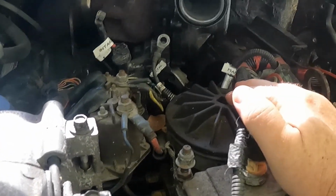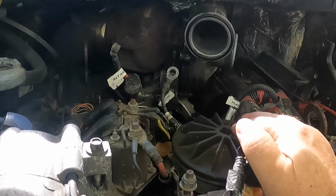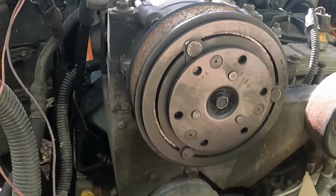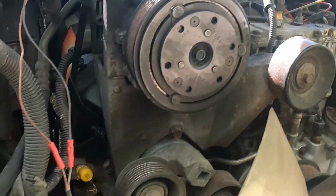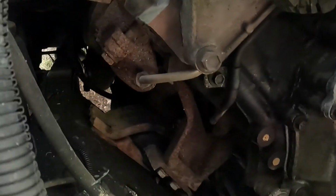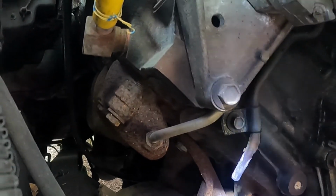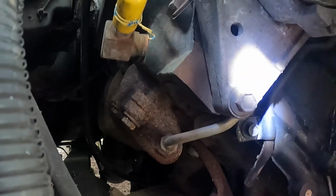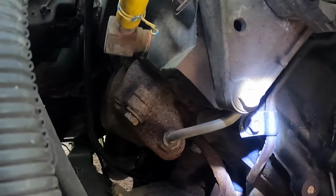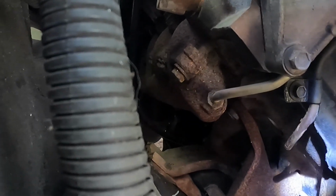So you guys know there's a ball valve on the back of the fuel filter to drain everything in the fuel filter. And what I meant by everything is not that it drains everything, but in typical Ford genius, and I'm going to come down below this idler because I got all my front end on. Oh, Lord. All right, so that nipple that's sticking out right there, right next to the motor mount and right by this lower bracket bolt, is the drain tube. And they have it cocked to spray all over everything under here, which is kind of really crazy to make it, you know, make a mess and hard to get in a drain pan.